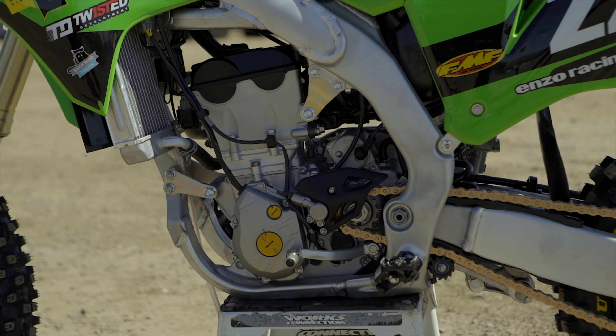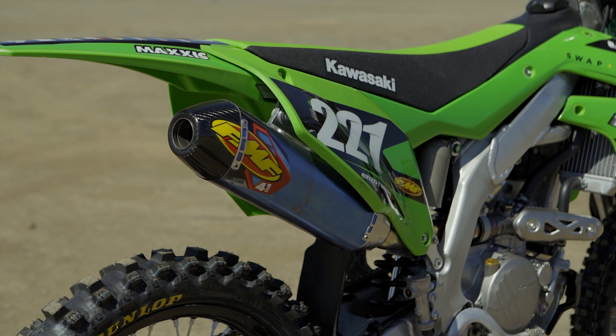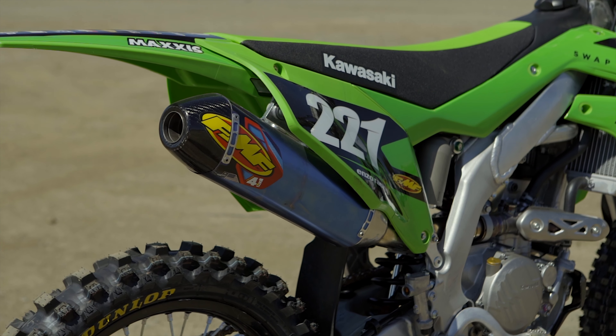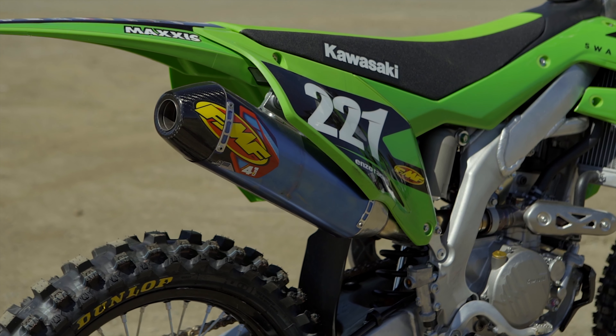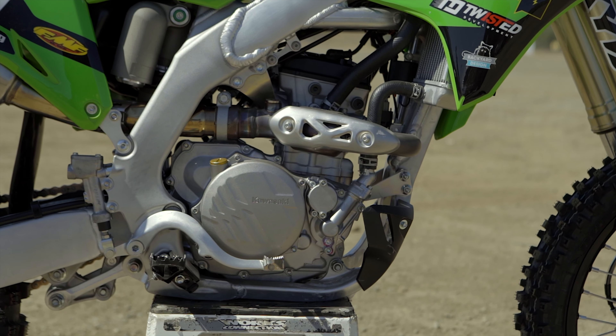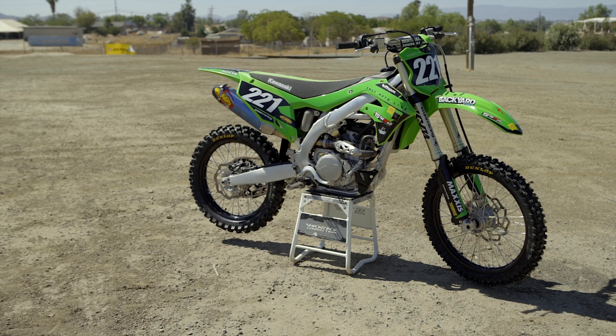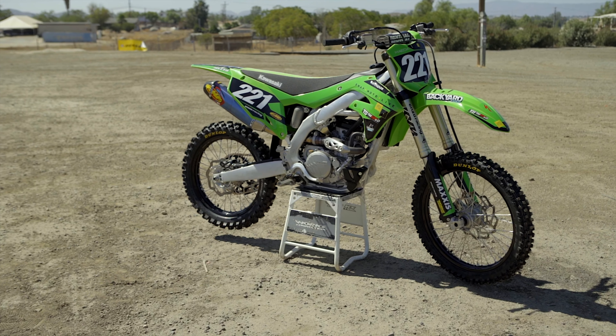As is the case with everything in motocross right now, it's hard to get aftermarket exhaust. So we went with the FMF slip-on and maintained the stock header pipe. Jamie advanced the intake cam timing, and the bike has VP Pro 6 fuel in it. On the dyno this thing's a beast — a lot more low end torque while maintaining the great mid and top.